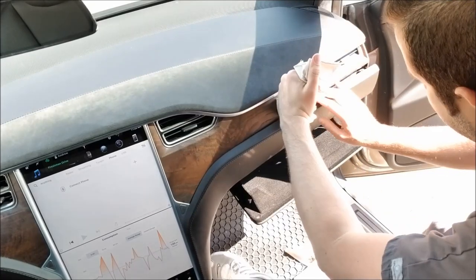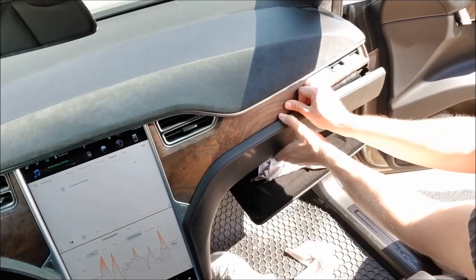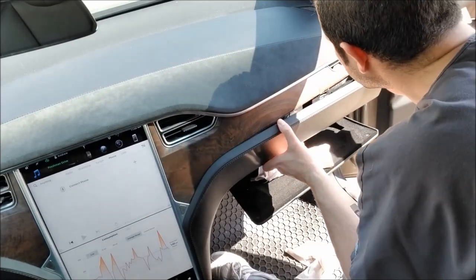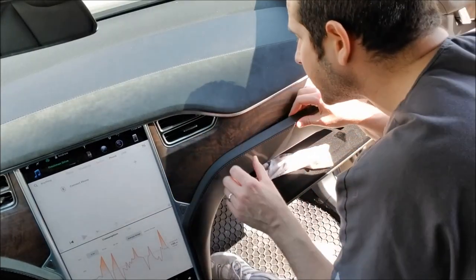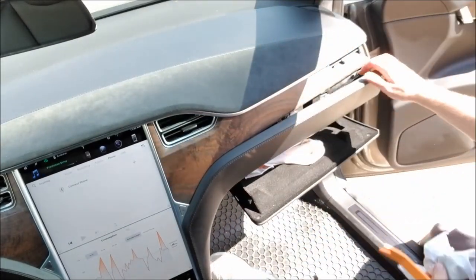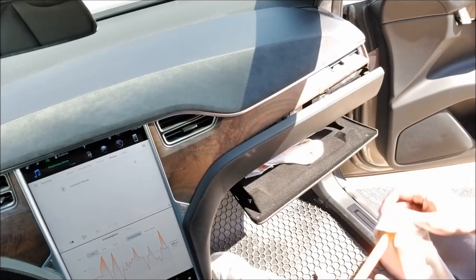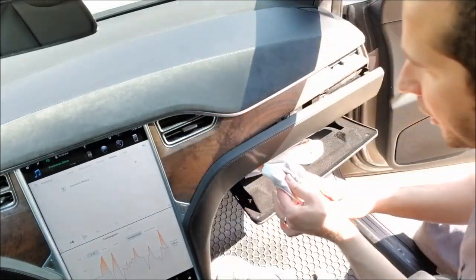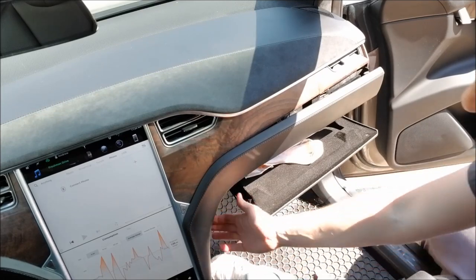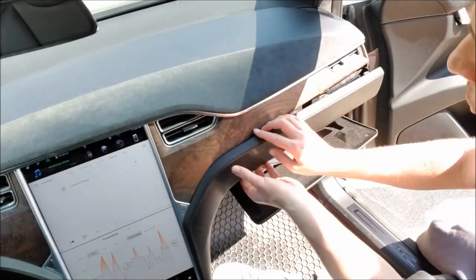Another clip located right here. Got them in there good. All right, as we get over closer, I can see there's another clip located about right here. As you work your way down, it gets easier, obviously, to spot them. Doesn't make it any easier to want to snap it off. And I know from pictures I'd seen in the past that there are also a couple clips here, and then there's clips that are recessed back here, but all of them are facing forward. So as long as you pull forward force, you shouldn't have too much trouble getting those out as well.